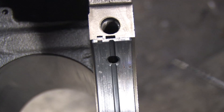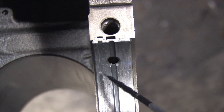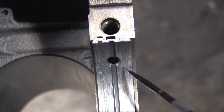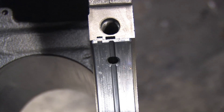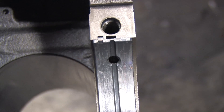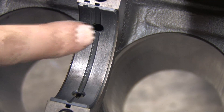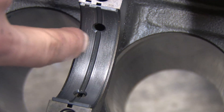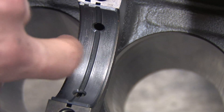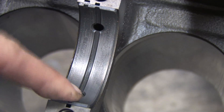Main number 1 is in pretty good shape despite the fact that the oil system was circulating metal shavings. These chunks of bronze are pieces of my rod bearings. There are also some divots and softer layers of the bearings embedded in the surface — those are the lighter colored spots. Number 2 is in really great shape too. There's a little bit of uneven wear on the right side, but the radius cut edges are still in the right shape. It was located properly and doesn't appear to have shifted. Any scoring is due to the shape of the block's journal — scoring isn't that bad on number 1 and 2, and I know that didn't happen until the rod bearings went.